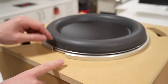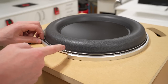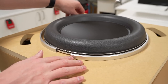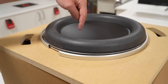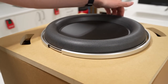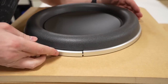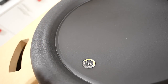Next, we can reposition the clamp ring. Make sure that the beveled edge is out, or towards the top of the subwoofer, and position the clamp ring seam where it's going to be least likely to be seen in the install. It doesn't necessarily have to be lined up with the logo on the subwoofer — it can be wherever you're not going to see it in the build. We're going to carefully get it started by simply pushing it on with our thumb, and in order to get a tight fit on the seam, we apply pressure incrementally as we go around the outside of the sub. Congratulations — you just installed the W7!